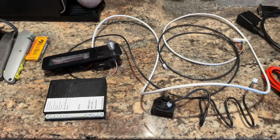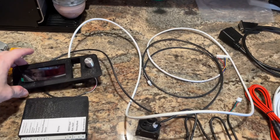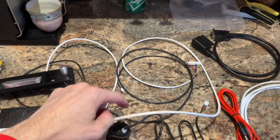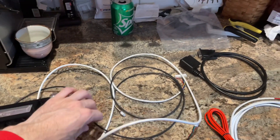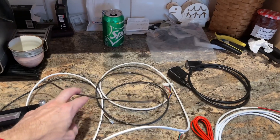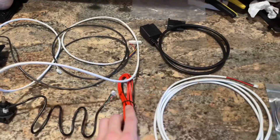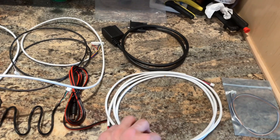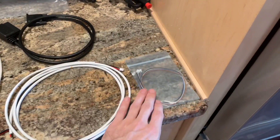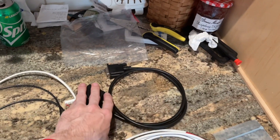This is everything that comes with the kit: the screen unit with the ashtray mount that has the necessary harnesses attached — the display harness that goes into the brain, the knob harness that goes into the brain, the brain itself, the boost pressure sensor, power cord, the boost solenoid harness (the extra long one), some harnesses for external sensors, and finally the OBD2 cord.